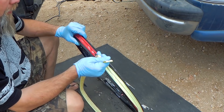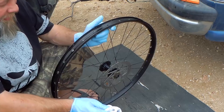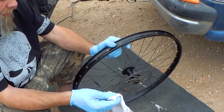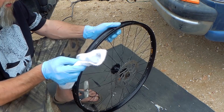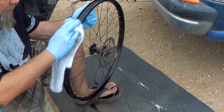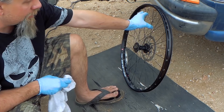Next I've got to clean off all the old crap. With a wet rag I'm taking off all the old sealant inside here — the stuff behind the tape and on the sides of the rim. It's important that the inside of these rims is as clean as possible so that when you put the new tire on it will seal. I'm cleaning the metal really well because it's going to get new tape. I'll do one last quick wipe down the middle and let this dry for a couple of minutes — I don't want it to be wet at all when I put the tape on. Then I'll go get the new stems and grab a Mountain Dew.